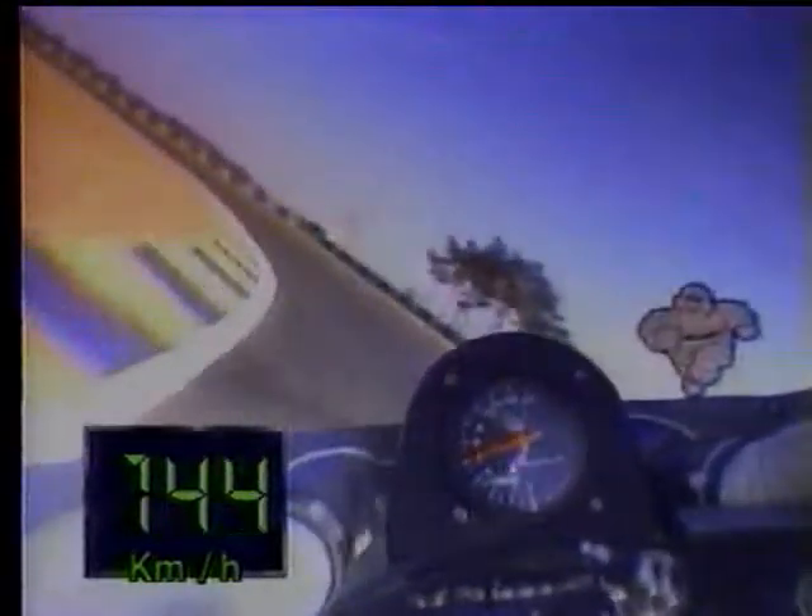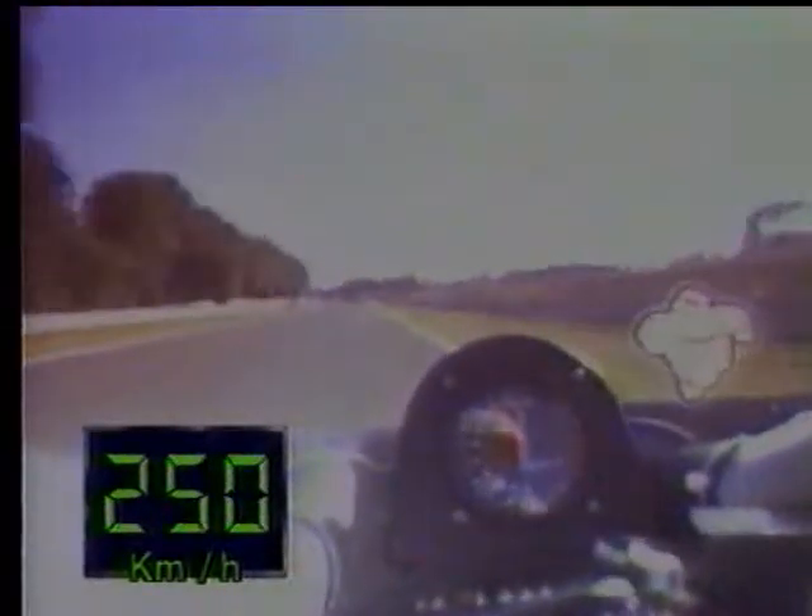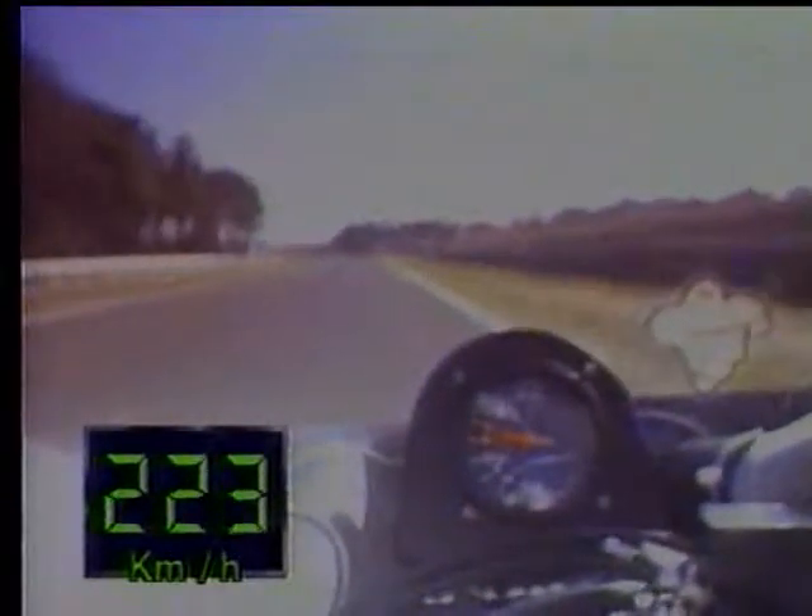The tire must support the load and speed, and the acceleration and braking torques, with minimal sidewall deformation. Note that a motorcycle tire works with significant camber and practically zero slip angle. The tire is the only contact between the vehicle and the ground. It is characterized by its deformability — its capacity to absorb road surface imperfections while minimizing reactions on the cycle part. Adhesion is the capacity of a tire to transmit forces on a given surface, and depends on the tire itself as well as the road surface and its condition: dry, wet, clean, or dirty.